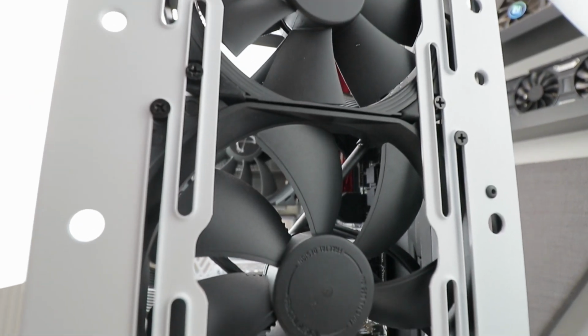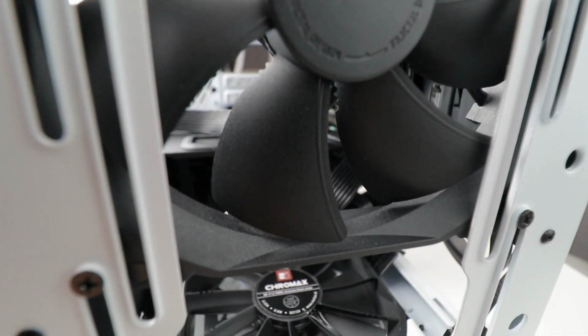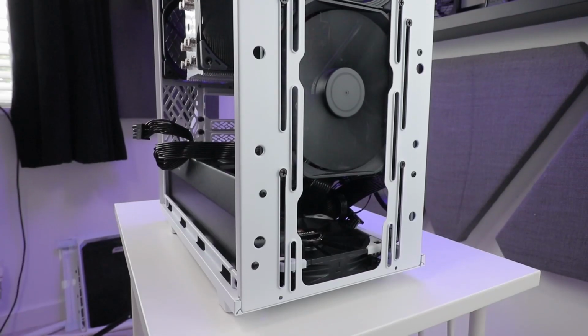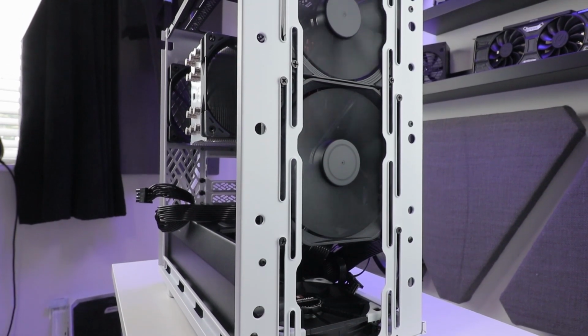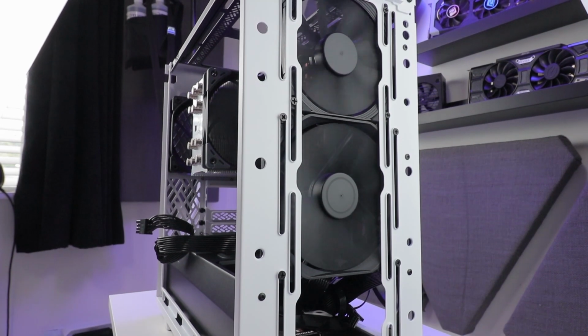Setup 3 explores whether the base fan position is useful for air cooling, so I added a second test fan as an intake here. Common misconception, more fans isn't necessarily better. Airflow from one direction can divert airflow traveling in a better or more useful direction from another fan, which can make the overall effect less effective. Naturally, the basement panels were removed for this setup.